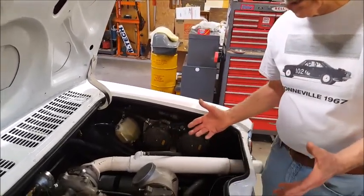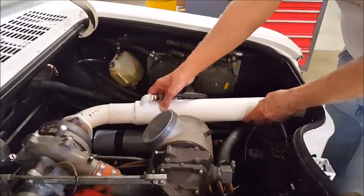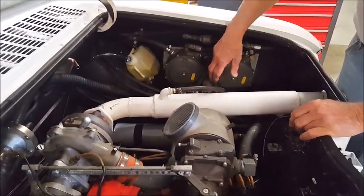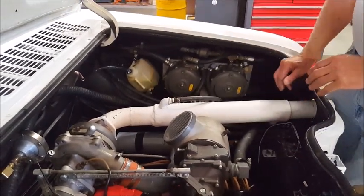Well, this is an air-cooled engine. Where do we get hot water? Well, I have to make it. So I have a water jacket around this exhaust pipe, and I circulate water. I use an electric pump, a marine pump out of the boat, and I circulate hot water through the converters and through this heat exchanger to keep things from freezing up.